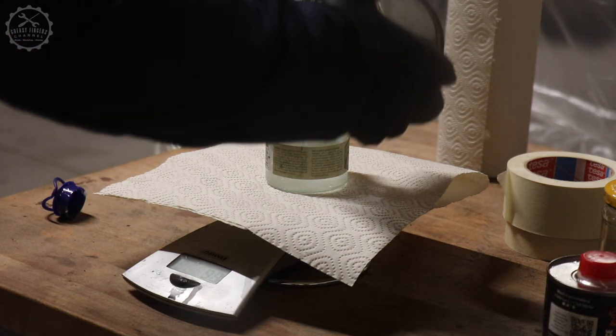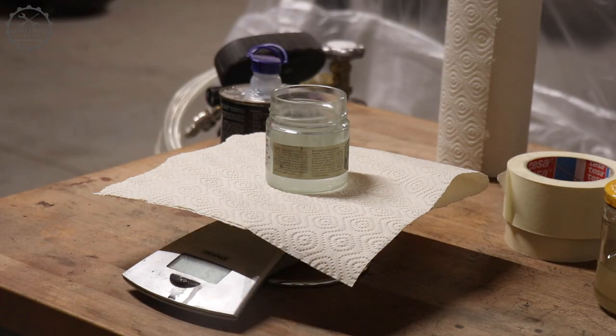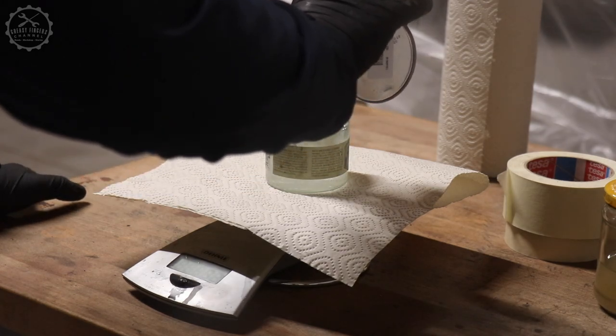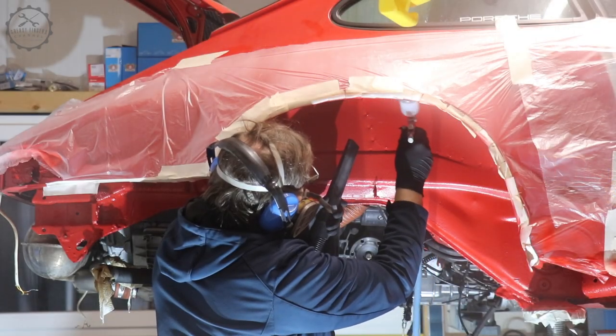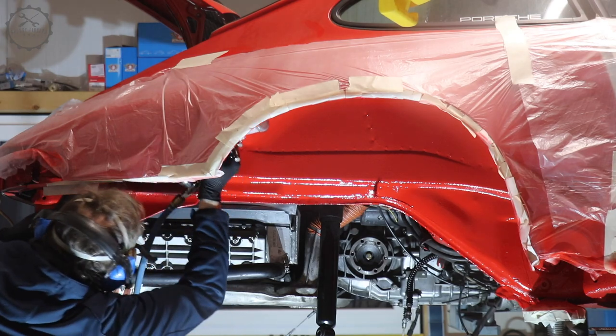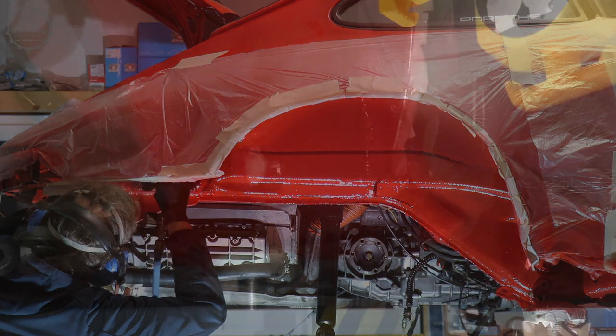As already explained in my recent films, I've learned to love working with water paint, but there is no alternative to covering it with a coat of two-component clear. And in the very moment when I put aside the spray gun, you have to know that I much enjoy working in the early morning hours, a beautiful dawn broke and drenched the workshop in magic light.